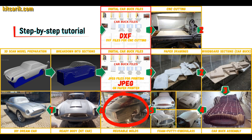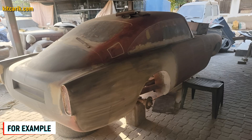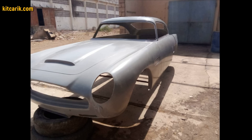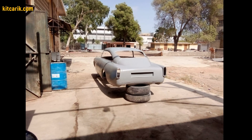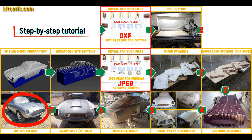Next, you need to make fiberglass molds for the further production of a fiberglass body. My client didn't have this skill either. The main thing is that once you make fiberglass molds, you can make many fiberglass bodies. A fiberglass body is made from the resulting fiberglass molds. All you need is epoxy resin and glass material — nowadays it is available to everyone. There is nothing difficult about working with fiberglass. The finished fiberglass body is installed on a suitable donor car or on a homemade frame.